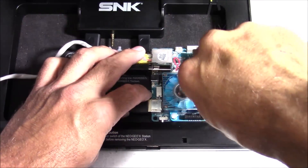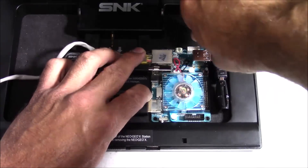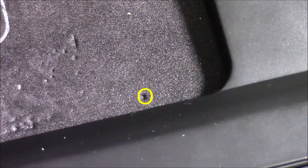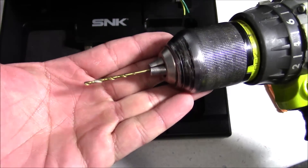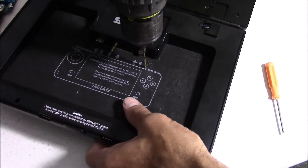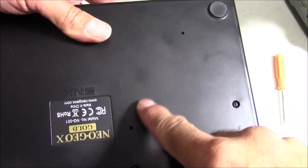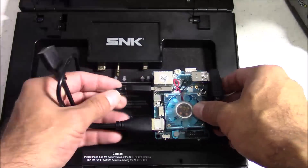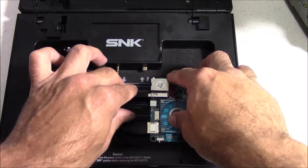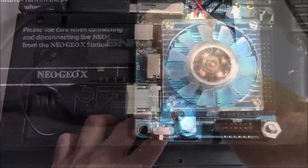Now that I have everything plugged in and in place, I've determined where I want the board secured, so I'm going to mark these holes. This step is not strictly necessary but I do recommend it — otherwise your board won't be secure and it can move around. To secure the board I'm using some very small bolts and nuts, drilling the holes slightly smaller than the bolts so they can thread inside the case. I'm securing it with two screws for now. You can also drill a couple larger holes through the bottom of the case for more ventilation — not necessary, but it could only help. Secure the XU4 with nuts hand-tight only — do not overtighten as that could crack the board.